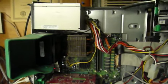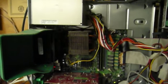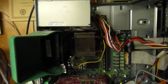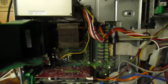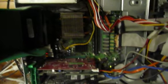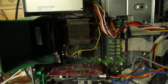I didn't leave the Celeron in here. No, instead what I did is I turned to eBay and I found a 2.8 gigahertz Pentium 4 Northwood with an 800 megahertz front-side bus. It is worth noting that 400 megahertz front-side bus processors are not officially supported by this Dell motherboard, which is based on the Intel i875 chipset and the ICH5 Intel I/O controller hub.